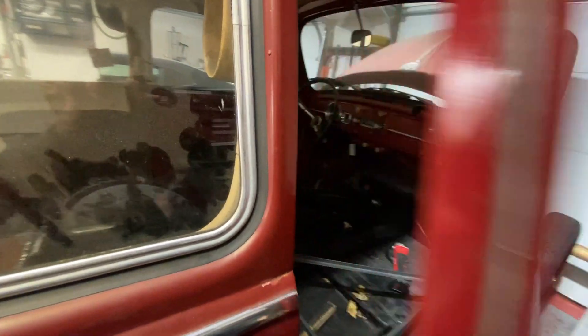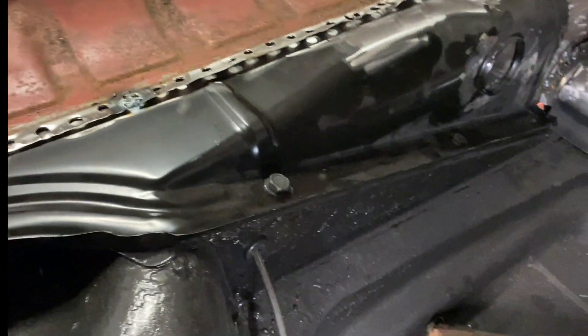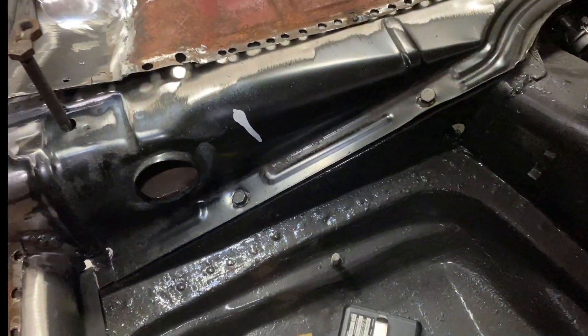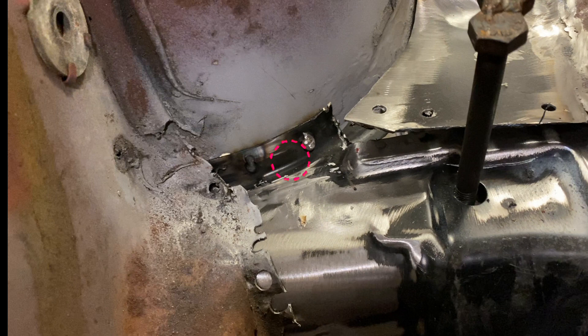Let's look in here further and show you what I've done. I spot welded the rear cross member — if you can see it back there. Then I spot welded a couple places on the cross member here, because I just want to keep it in place — eventually you have to take these bolts out, so mainly for movement. Did the same thing on the passenger side here — seam welded the heater channel there, spot welded the cross member there.